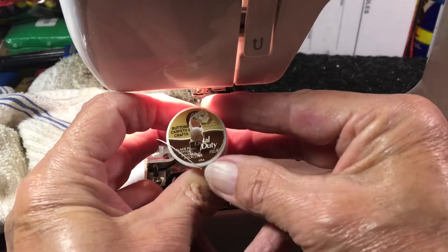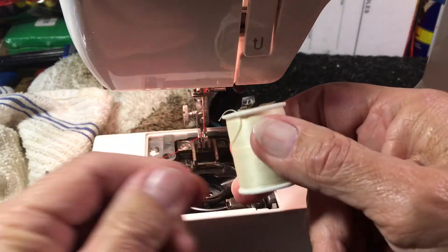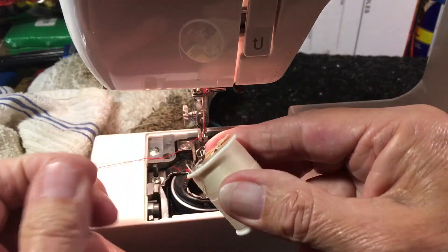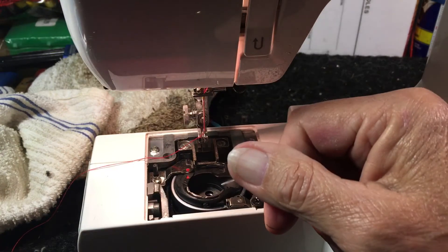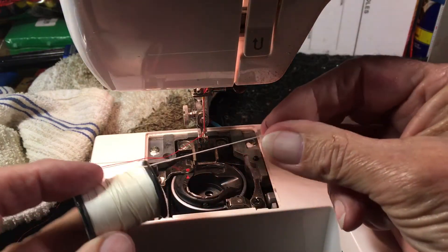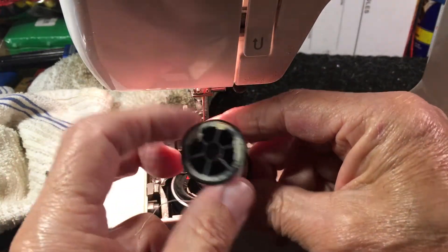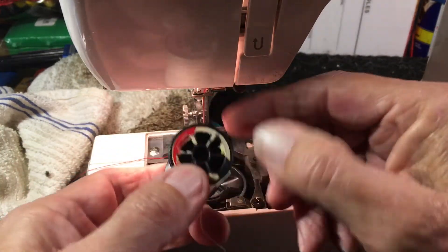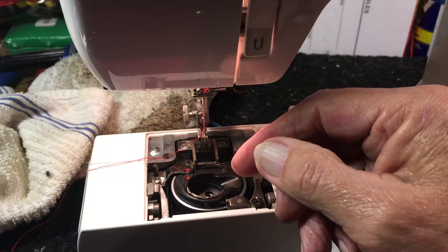What's another one? What does this say? Buttons, carpets, and crafts — oh my word, that is so heavy. That will not work. It won't slide through the thread gap. It'll flip your bobbin up and jam it. People ask me, is there a difference in thread? Yeah, this stuff is like rope, it's so big. There's no label on the end — I ask ladies on the phone, what kind of thread are you using? They don't know, the label's gone. Well, if the label's gone, it's going to be risky business.